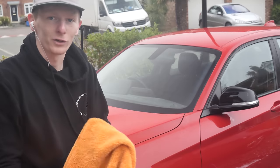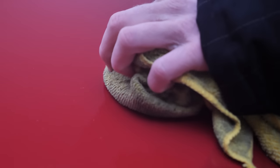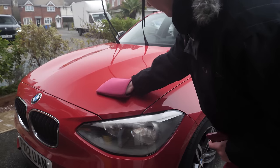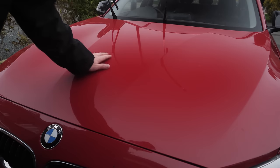I've just finished cleaning the car — it is bloody freezing but it looks pretty good. The paint's in all right condition; it's got quite a lot of chips where the paint's coming off and a bit of lacquer peel on the plastic parts. There's a lot of tar on it and some black spots on the top which we'll get off. I'm going to dry it off and then get back out to get the tar off and start clay barring. The car really needed a clay bar — one side was rough as sandpaper and now the other side glides just fine.